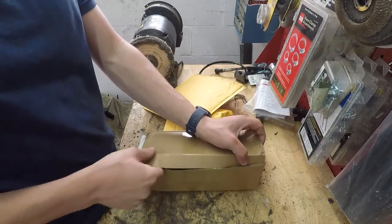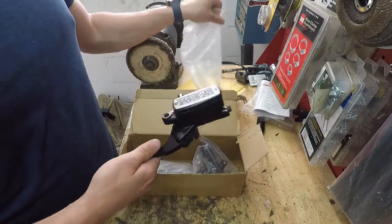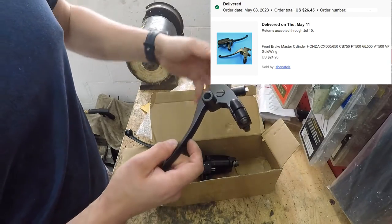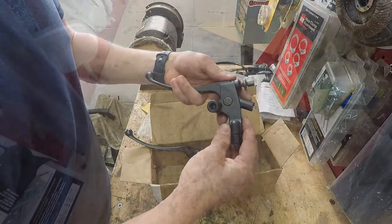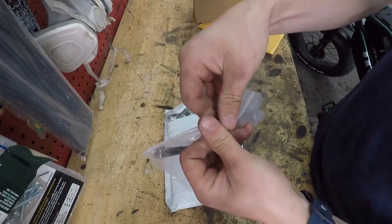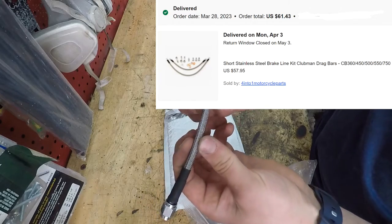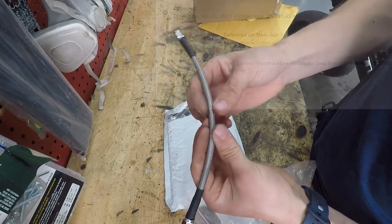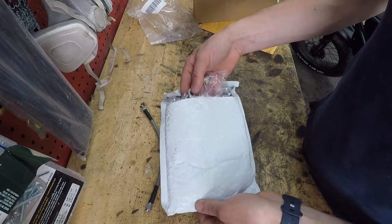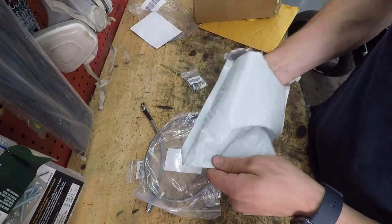Before we do this front brake upgrade we're going to need some parts that just were delivered yesterday. In this box we have the new front brake master cylinder — couldn't believe it but both the brake lever and my new clutch lever were only about 25 bucks on eBay. The actual upgrade is replacing the old stock rubber lines with stainless steel brake lines. These are way better because they can't expand like rubber lines. After they get old, rubber lines start expanding and that leads to at least a 50% loss in brake hydraulic pressure, so you want full pressure to operate your front brake caliper.